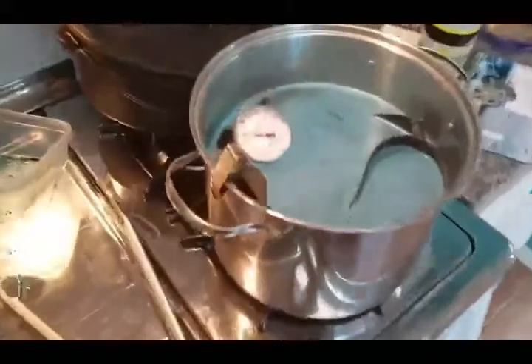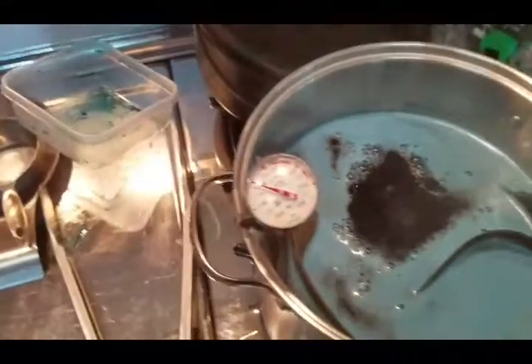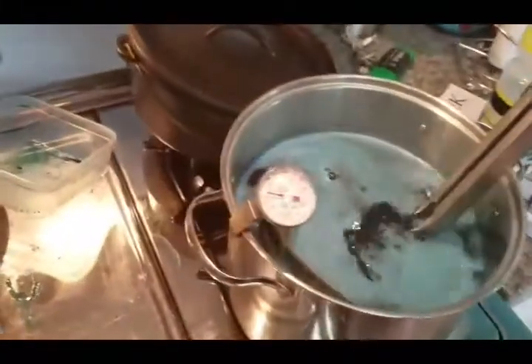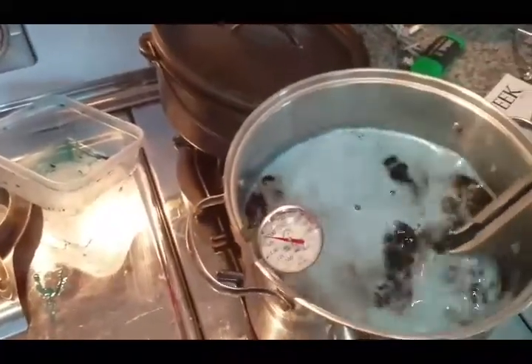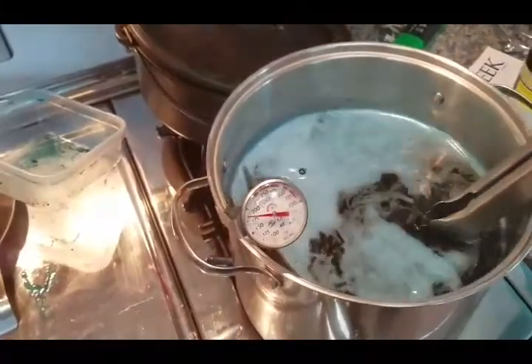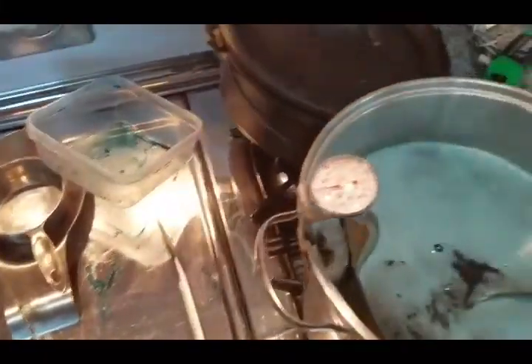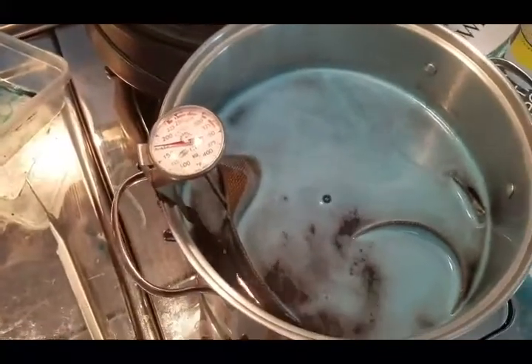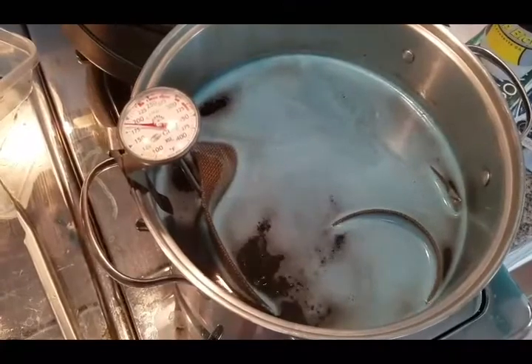Many people have talked about acid dyes possibly weakening seatbelts. I'm not going to tell you whether this is safe or not because I don't want to be liable, but I've seen people test dyed seatbelts before and after and haven't found a noticeable difference. All we're talking about is some dye, some vinegar, and some warm water. This is a 50-year-old car — it doesn't have the safety standards of a new car in any way, shape, or form. So one teaspoon of dye, a quarter cup of vinegar — you want to let this simmer, not boil, for a half hour or so until you get the color you want. I'll monitor the temperature and let this thing go for a bit.